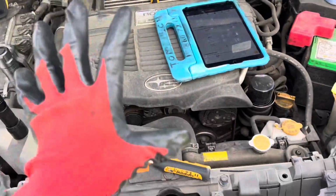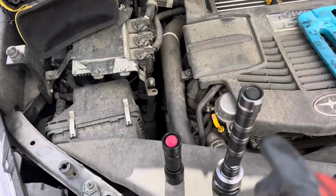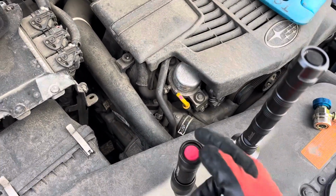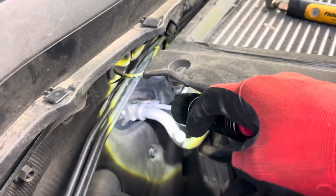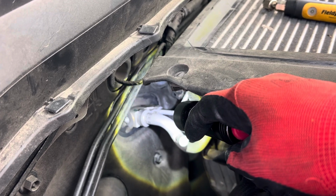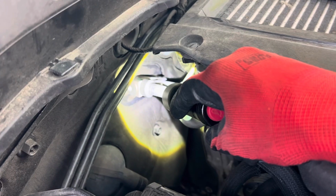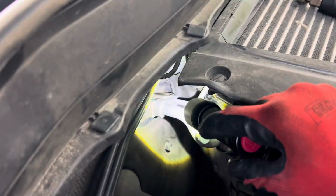I'm not even gauged up, but I did a look around and you're going to look with me. We're not even going to start the vehicle yet because we just want to see the visuals. So visual, let's get that out of the way. We look back in here and we see a little bit of wetting and dust collection around the rubber, but not really going down the lines. The lines are dry and clear and they don't have a dust buildup.